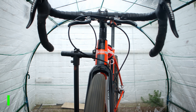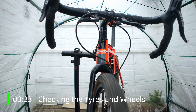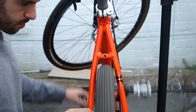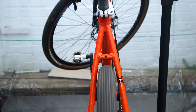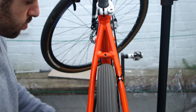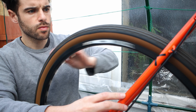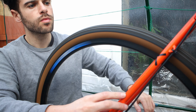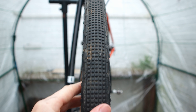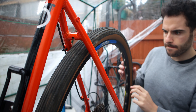The first part of my gravel bike overhaul and likely the hardest to get right is the wheels. First things first, I want to check that the wheels are running true. I'm going to do this by simply spinning the wheels in the frame and then checking them by being in line and seeing if they run true against the frame, looking for any sideways movement of the actual wheel itself. I also want to be checking the tyres — no slits, no damages, anything that can cause issues when I'm out on the gravel.